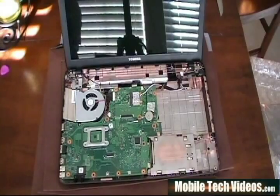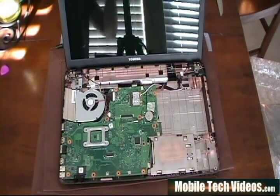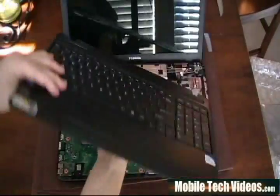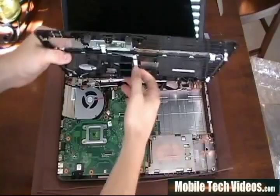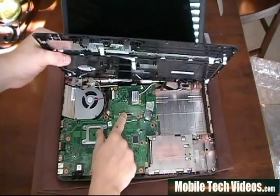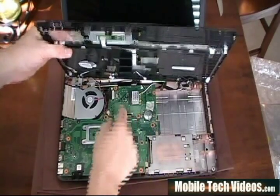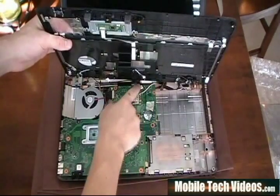So once you've gotten all your wiring back in place as well as mounted the monitor, you can prepare to reinstall the top cover, and we'll go to the next step after that. It's time to reinstall the top cover — this is going to be a little bit tricky. We need to get the ribbon cable for the keyboard back in here, as well as the touchpad cable back here. We also need to get our power button plugged back in here and our speakers plugged in here.